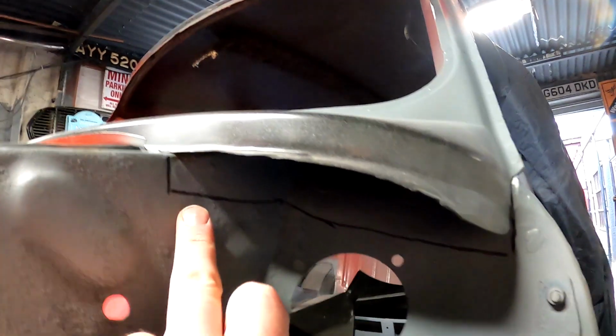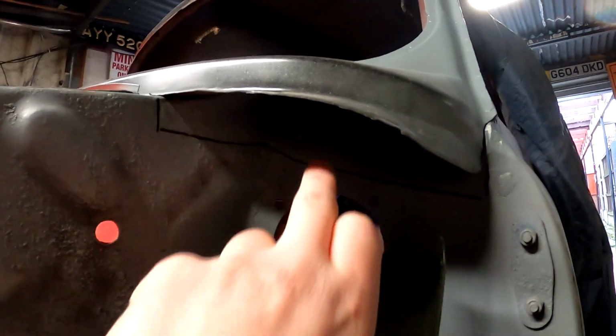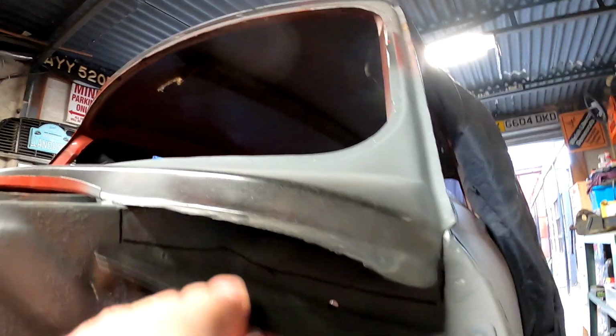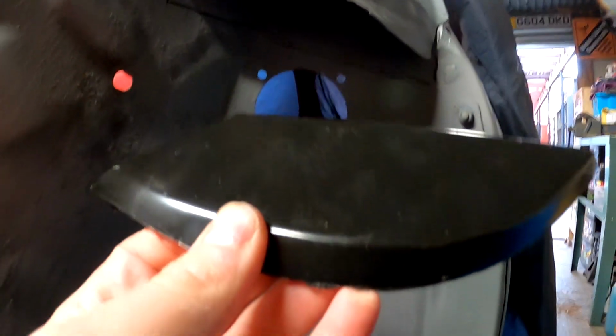I can now prep, or technically I've already prepped all that, but I can now mask off my lines. I know where my panel's going to, clean all this back to bare steel for nice stitch welds, and then we can shove all that back, nice paint, and then block all this off. And it's a big part done then, so 2 more panels on the car. Let's get going.